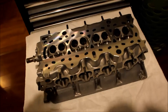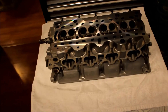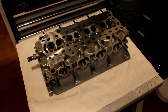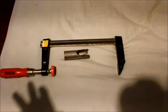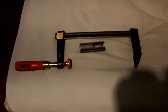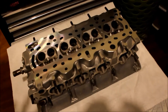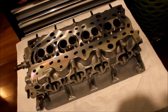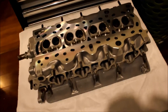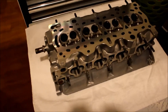I'm going to need to re-lap the valves. Not going too far into detail because there's tons of videos on it already. Before I actually put everything back together, I'm going to be ordering or trying to find some dual springs out of either a stock B16 GSR head for the exhaust side, or I will order the Blox dual valve kit. Either way, I want to have dual valve springs on both sides because I'm going to be revving it quite high.